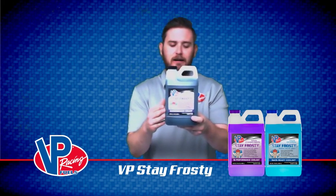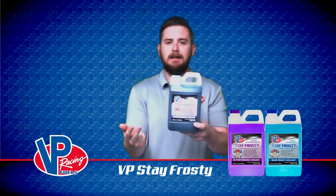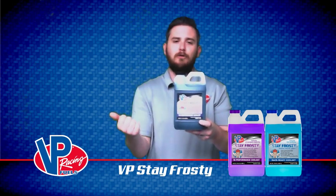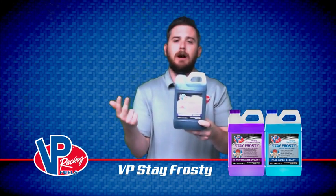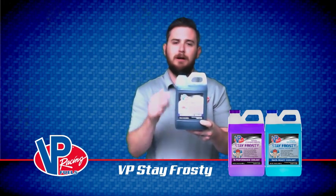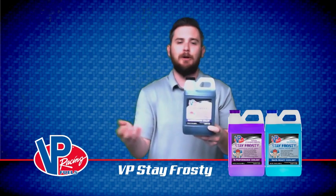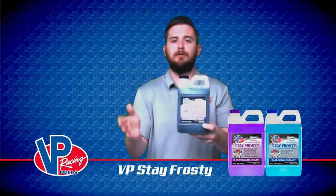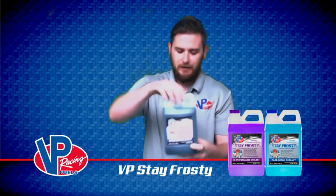In addition, with the glycol, the corrosion protection, and then the surfactants, this is really a well-rounded product that's going to work good in your performance, your street application. Don't use it in racing because it does have glycol. So if you're out at the track, most tracks ban this type of product. They don't want any glycols on their track because it's a very slippery substance. We all know what that causes. So this is great for your street performance crowd that wants a little bit of oomph in the coolant department.